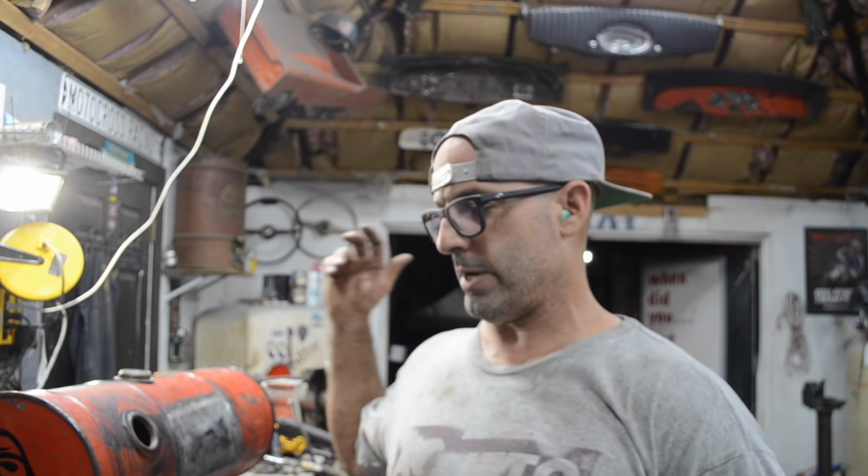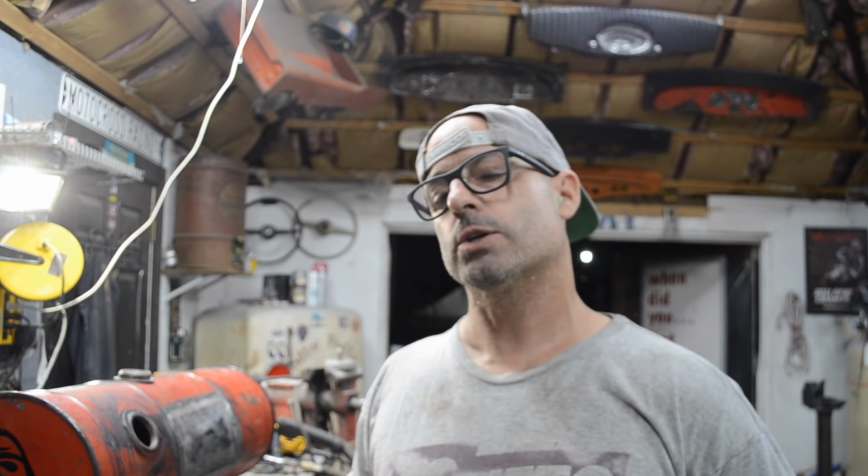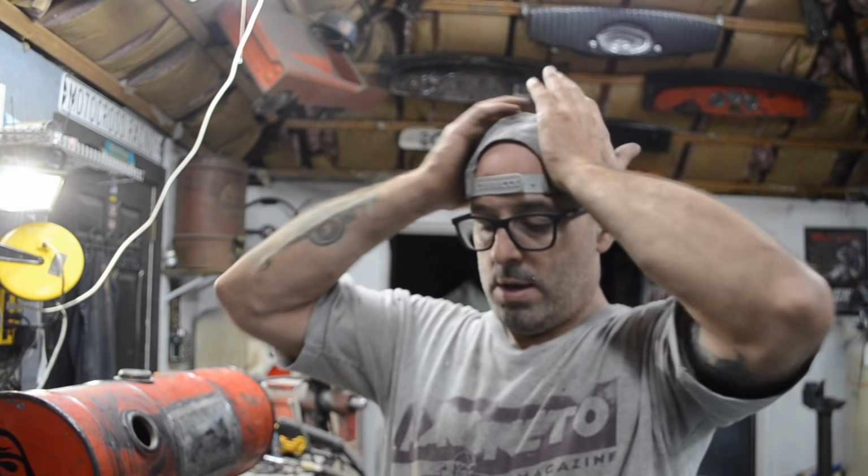It rained out the other day and I wasn't able to really work on the T. But I was able to figure out the steering. I think that cross steer is actually going to work out. I was able to move that steering box forward about 6 inches. I'm now able to run the aftermarket headers on it. I did have to modify the driver's side header to fit the steering tube.